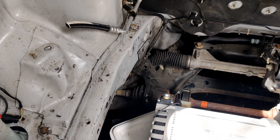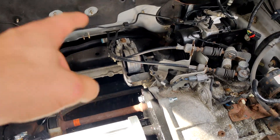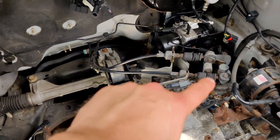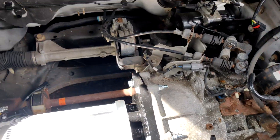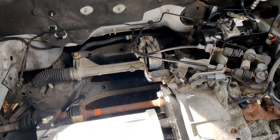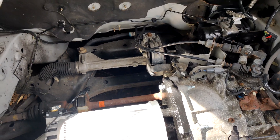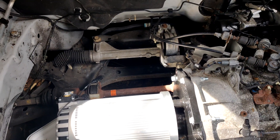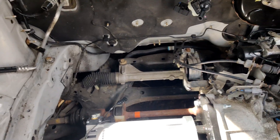So I'll reuse that original engine mount. What I'm thinking is I'll build some kind of bracket so I can connect the battery box also to each of the three transmission mounts. That'll give it a four-point mounting system, which should be sufficient. In total it's probably going to be about 150 pounds heavier up front than stock, so it shouldn't be a big deal.